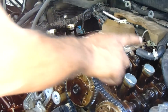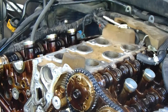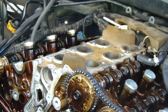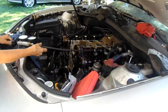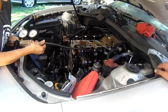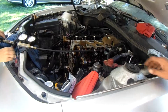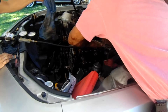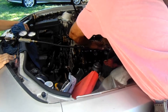What we're going to do now is go to this side and check these two while we got it up, while we got these out already, and let's go ahead and confirm this side too. Sheila's hooking up the leak down tester. Alright, we're now shooting air in this cylinder. These valves are good — you don't hear anything.